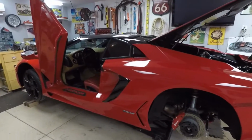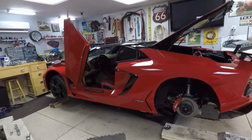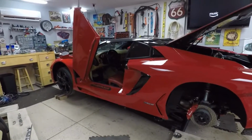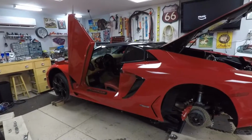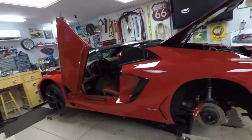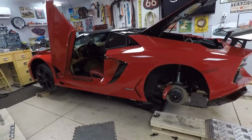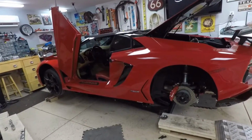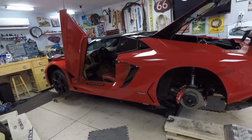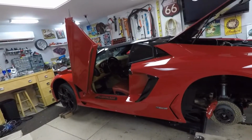And the interesting thing about that is that sometimes the trouble codes you get on cars can mislead you because they're so generic. Mine had a minor leak and a major leak. Obviously if you have a major leak, you're going to get the code for a minor leak too. I always got those together for that issue. Every time I reset it, both of them would come back, which kind of makes sense. So I think it wasn't opening properly, or it was stuck open sometimes or stuck closed all the time, and now it doesn't do any of that.